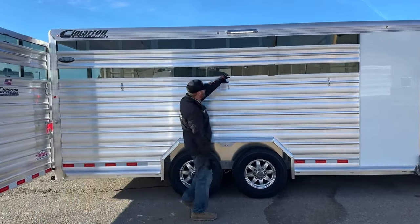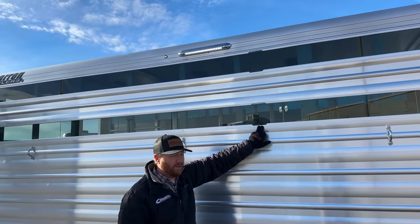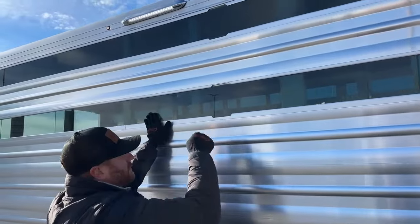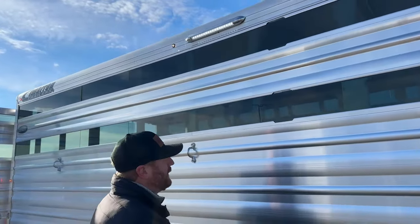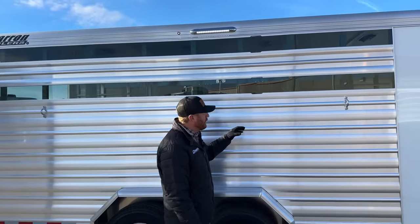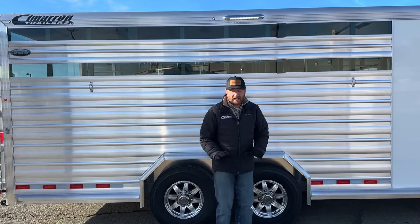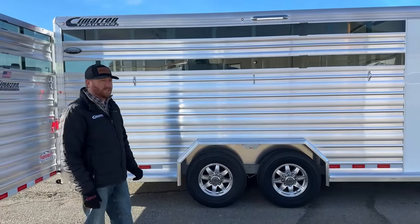Here are your two air gaps. There's a notch in every Cimarron stock trailer, so even if you don't have plexiglass, this track will already be there and you can add it after the fact. To remove the plexiglass, use a pocket knife to bend one piece out and they slide out easily. The largest piece is a four-foot section, so it fits in that tray up top. Since we're dealing with a slant wall, we have different lengths to these air gaps — so tip: use masking tape and a Sharpie to label each piece (passenger lower, passenger upper, driver's lower, driver's upper). It saves a lot of hassle when putting them back in.